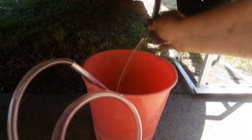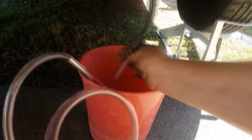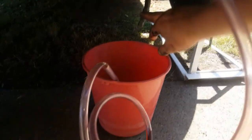I'll put a bit of clear hose on that, but actually I'll take the clear hose back out because it's a bit smaller — I don't want any restrictions. So when I start the car we'll know which way the transmission fluid flows. When draining, the workshop manual says for a minute or less — so as soon as the fluid stops flowing, that's when you turn the car off. If you leave it more than a minute, turn it off even if it's not finished flowing. That's what the manual says, so we'll follow that.